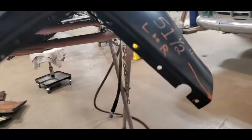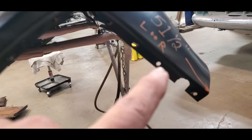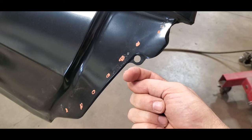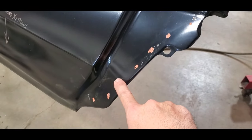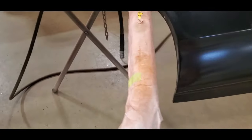Coming around to the back, I've got all my holes punched around here because that's what we'll weld the tail panel in. You don't see any holes here because I'm actually going to weld through the trunk drop into this piece — so these were just here for reference, I'll clean them off. Same thing down here — I'm not welding through this way, I'm going to weld through the other way. All the holes around the wheelhouse are punched.